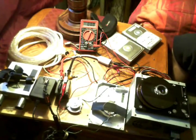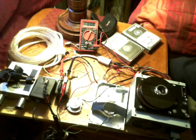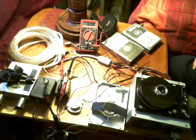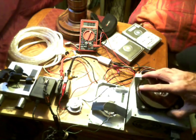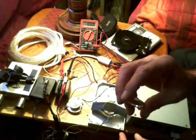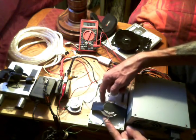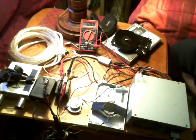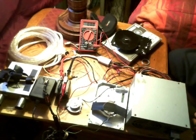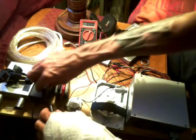I wanted to see if this thing had enough RPMs, and I needed a power supply that would actually run the normal circuit board in these old hard drives. I took a bunch of these rings, stacked and taped them all together to make a coupling so that this motor here would match up with the motor on the bottom and stay as stable as possible. It's not perfectly stable but it does work.